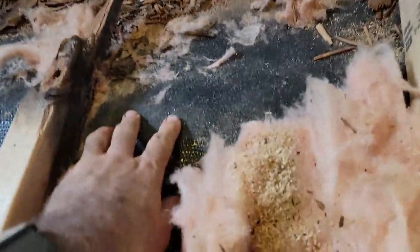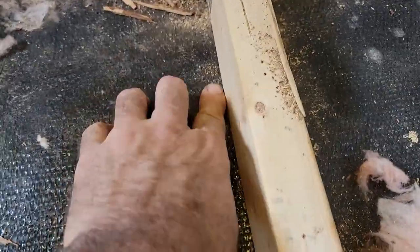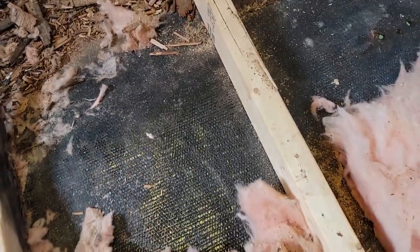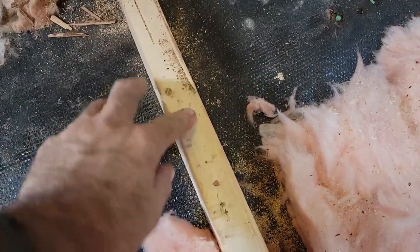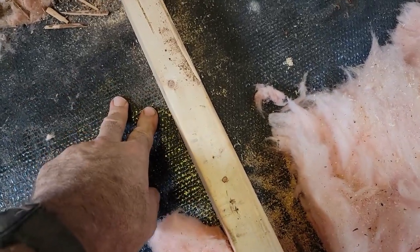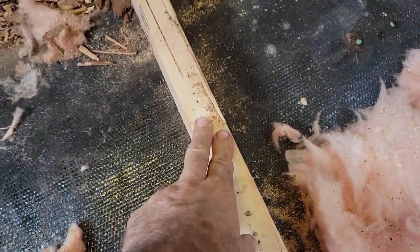Something we need to consider when making these changes: right here is a metal support frame — that's metal. This board here is sitting on it, and so is this one. When I make my replacements I need to make sure I'm not having a joint that is in between these bars. I need to have it supported by at least one of those, so both boards are supported by the beam that goes under here, because this is a metal beam support for the trailer frame.